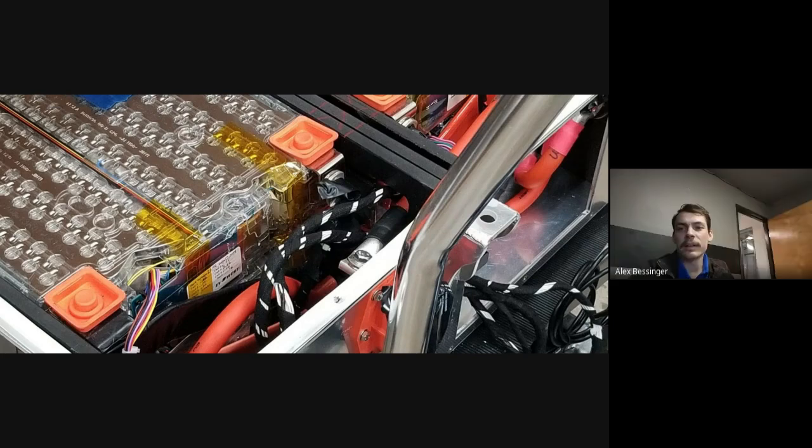Right, yeah. I would say that the driving style can play a factor, but I think overall it's more likely that the battery had some physical issue with the cell, and letting the car sit and balance can help it. But at the same time, if it has an actual problem and it keeps rebalancing itself like that, it ultimately just doesn't pop up until later on. So it was probably a pre-existing issue that popped up early enough that, man, we can't blame Talik for this.